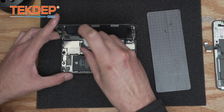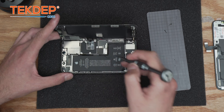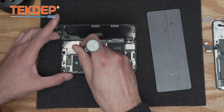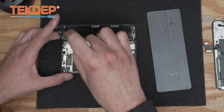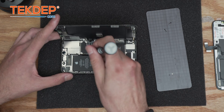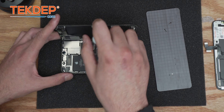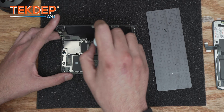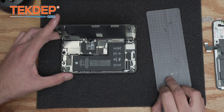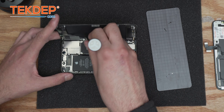After you remove the screws from the battery connection, don't do everything at once. The first thing you need to focus on is disconnecting the battery. It is very important to disconnect the battery — number one, to make sure there's no electrostatic discharge onto the board, which is a recipe for disaster and can short circuit chips more often than you'd think.